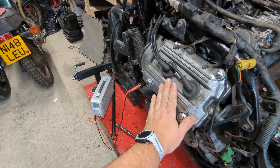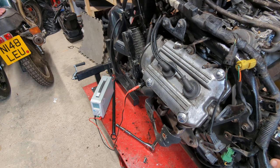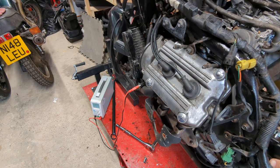The cylinder head's a cup of tea temperature. There's a bit of smoke off the exhaust headers and everything because they haven't been run in ages. But so far, so good. We started running out of petrol in the carbs, which is why it started spluttering and coughing back. Normally it's got a fuel pump pushing it in there. In this case, it's just a bottle, so I have to squeeze it. When it was running well, it sounded fantastic. So no worries there. I think I'll bring you back after I've turned the fan off.